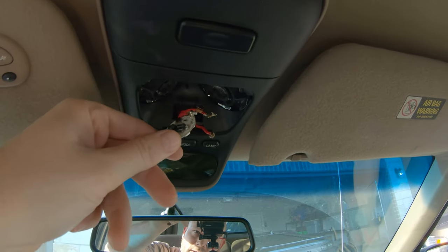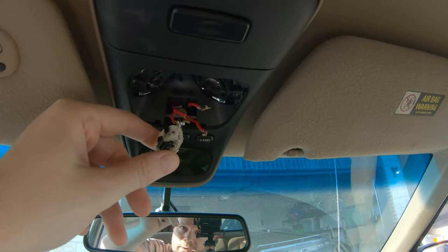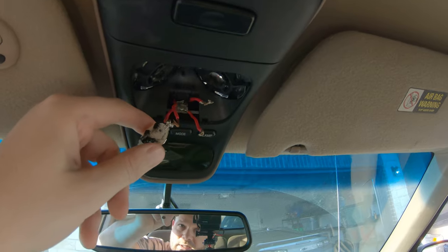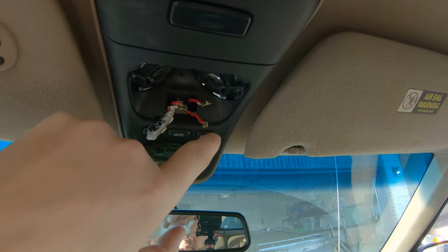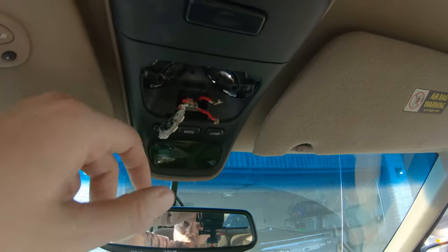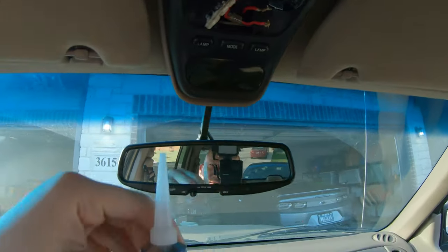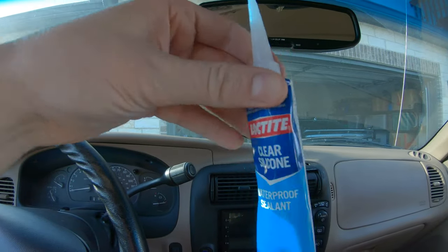This was falling into the lens here, so I removed the hot glue. The solder joints have kind of come loose. I'm not going to do a full rebuild. I'm just going to cut these messed up ends here, solder in a little bit of extra length of wiring with some heat shrink, and then I'm going to re-solder these discs on and then use some, hopefully, clear silicone to hold them in place. Hopefully this can withstand the heat.